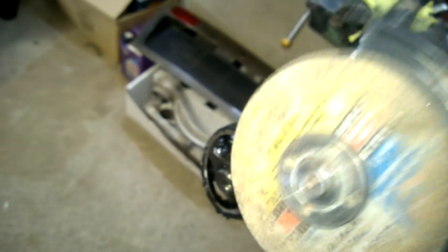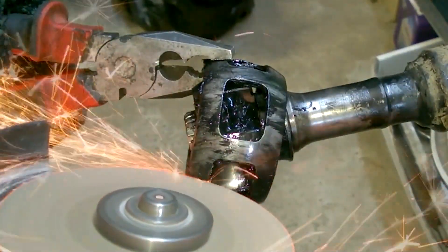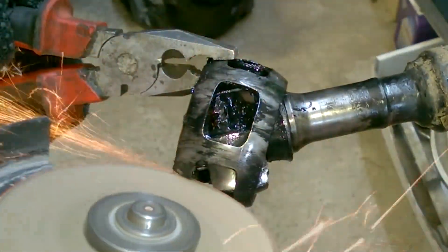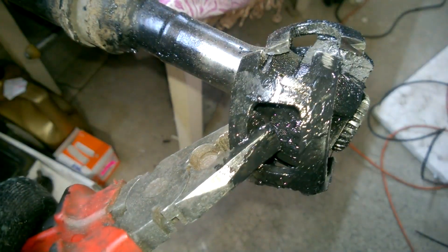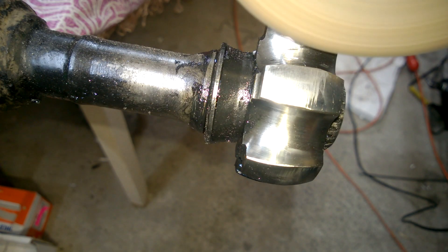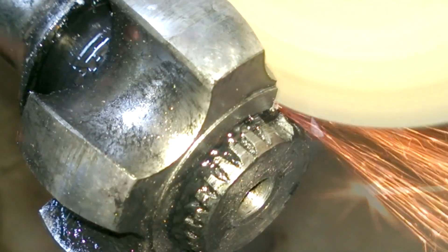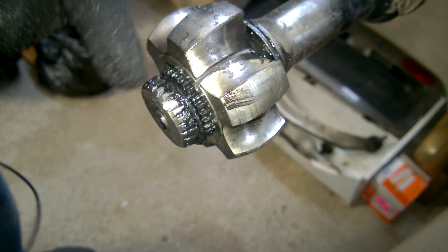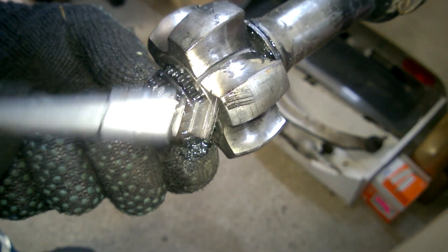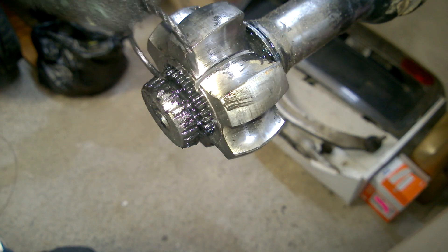So now I'm going to take a cutting wheel and gradually grind down the race. After I cut the cage and almost completely removed the race, I was able to push the race back enough to expose this strange circlip and take it off. Look at how stretched out the circlip is — that's why it wouldn't let the joint come off.